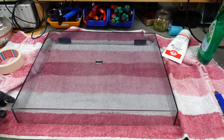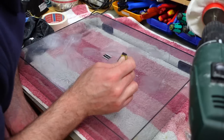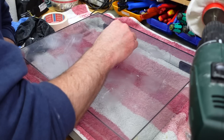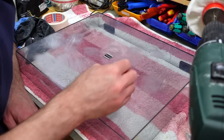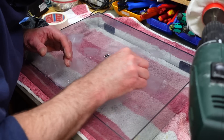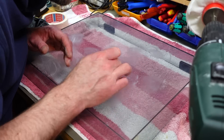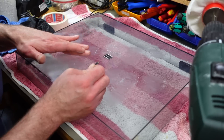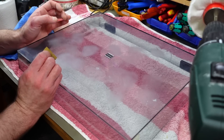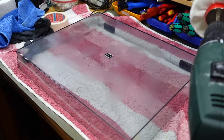I went to some wet sanding with 1000 grit sandpaper and some of these are actually going away now. So I'm going to do another pass with 2000 grit sandpaper after this, just to get this down to a finer sand, and then polish again. These are some super severe scratches — usually you don't have to do this as meticulously as I'm doing it now. We just have some quite severely deep scratches in here. Of course it looks even worse now than it ever looked, but this is the way. Another pass with 2000 grit sandpaper and then we should be good to go.